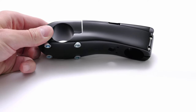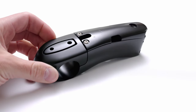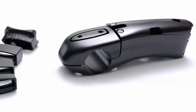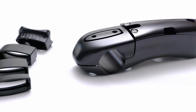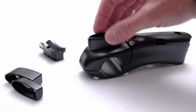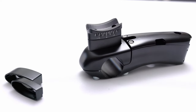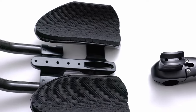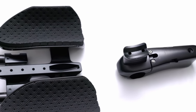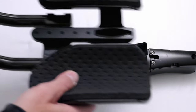And whether you're on rim brakes or disc brakes, Sigma-1 still offers the same tidy center-pull routing as every stem we've ever made. Adding the optional mono-post compatibility kit takes the system to a whole new level. We took the same technology that makes Alpha-1 so special, and then ported it to a stacked spacer setup, so that it can function on Sigma-1's stem clamp. Just two bolts set your stack, tilt, and lock everything in place.